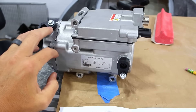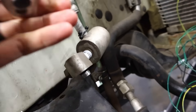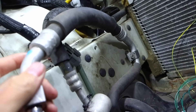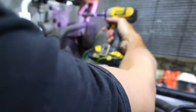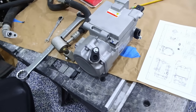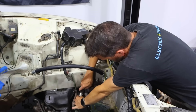The challenge is that the suction and discharge ports on this compressor don't necessarily match the lines in the car. I believe this is the suction line and this is the discharge line. One of them matches, but one is too small. I've got a local shop that will make custom AC lines, so I'm going to unbolt these and get them over there for new ones. I took the AC hoses off the Nissan and got new ends put on so we can connect to the new AC compressor.